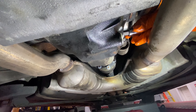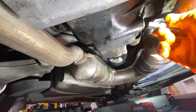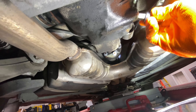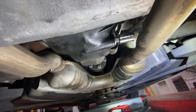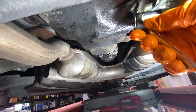This is the fill right up here, and this is the drain. I've loosened both of them — it takes a 14-millimeter Allen. One of the challenges is that the exhaust pipe gets in the way. I just inserted the tool, took the 14-millimeter, and loosened it.